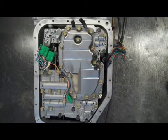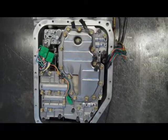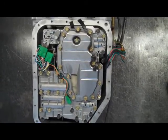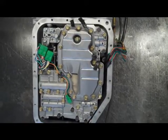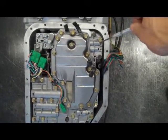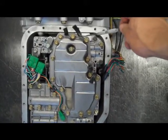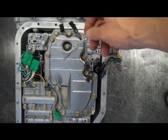I have this set in here so you can see which bolts are required to remove the valve body. The black ones are fairly self-explanatory — there are 13 altogether that hold it to the trans. The ones that are not black are here, here, here, here, and here.